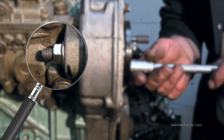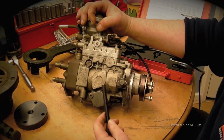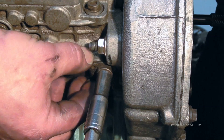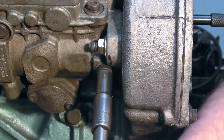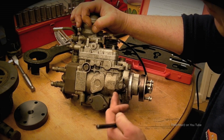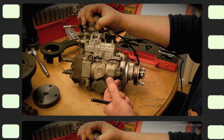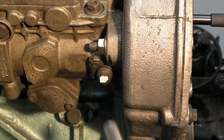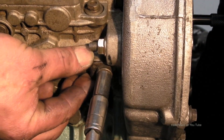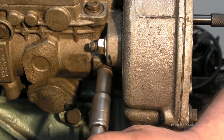Because the pump is still bolted to the flange on the timing case, don't push it or it'll cause damage. There is a locking peg on the side of the pump — you undo it, slip the plate out, then screw it up to lock the pumping body so it won't move. If you're taking it off and putting it back on, be aware that you have to put the plate back in to pull the plunger away. Don't lose the plate — it's a precise measurement. Screw it up to lock the pump, and use the timing pin.